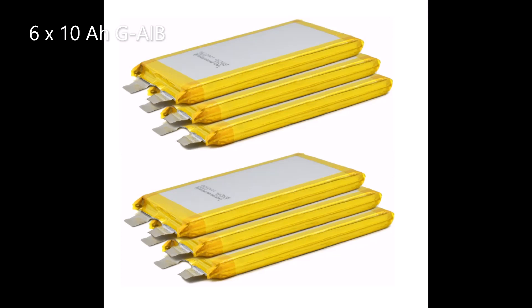What about the crank? We saw on the scope capture that we have that 400 amp plus initial spike. That can be up to 600 amps, but only for less than a millisecond. We know that the GMG battery is good for 60C and it can do it for the discharge cycle. So 60C times 10 amps — it's a 10 amp hour battery — equals 600 amps. No problem there.